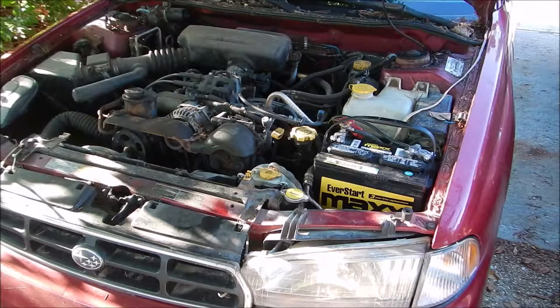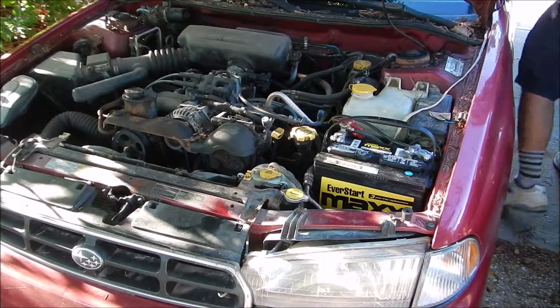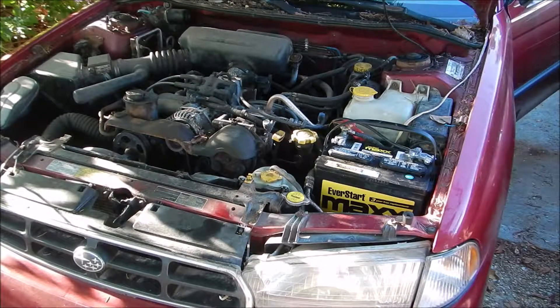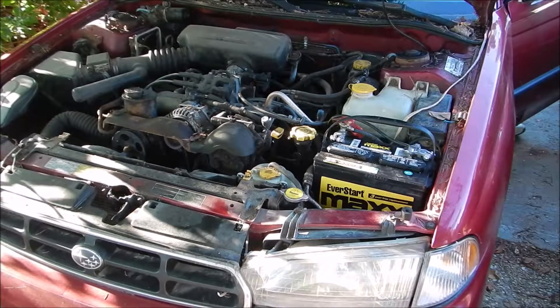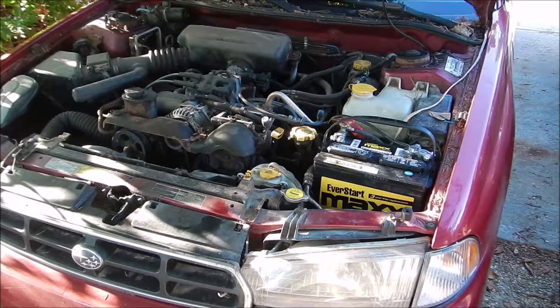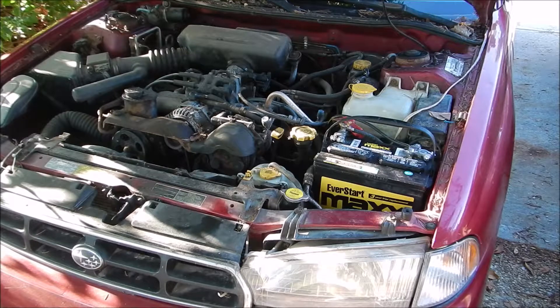Moment of truth — I'm going to start the car up, the Subaru, with the desulfated battery. It didn't fully start the car, but it was a completely dead battery and it's almost starting the car — just shy of it. I'd say this product is probably worth a try for marginal batteries. For completely dead ones, it's a gamble. But if a replacement battery is 100 bucks and this product is 15 to 20 dollars, it might be worth experimenting.